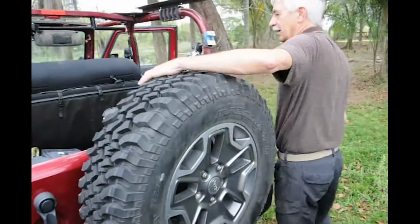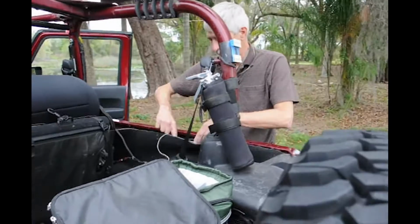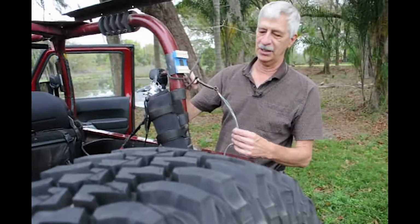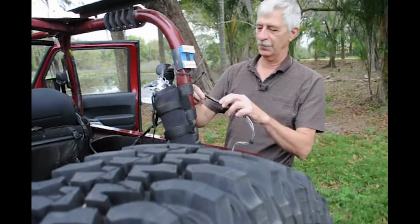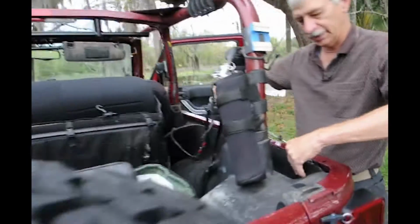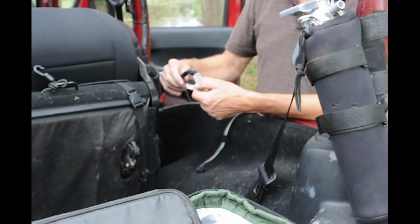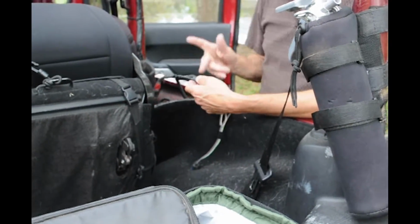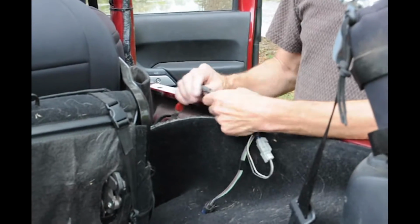So when this third brake light, when you cut it off and you pull this cable, the one that used to run out on the door is right here. I simply pulled a lot of the casing off. Actually, these are your little clips. This was inside the door. I just brought it around, put it up here, because this is where I wanted to make my connections. So it had a nice little clip and then a wire that used to run to the third brake light. So I cut that off so I'd still have their clip. And into that wire I spliced my 2.